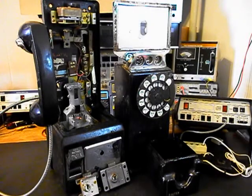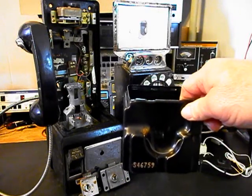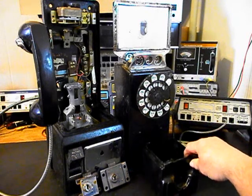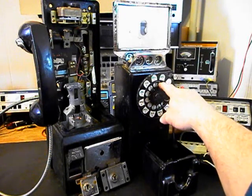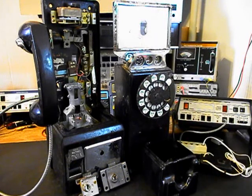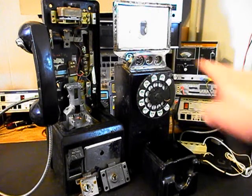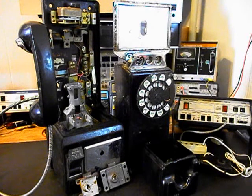We need to locate some locks and keys — a lock for the front cover and a lock and key for the vault area. When we gained access into the unit, we found a coin box, which is a plus. We want to go through the rotary — oil, clean, and adjust it. It is very sluggish, so we'll get that taken care of. We also want to install a dial center card and ring. Merlin is going to take care of the top card sign, the informational sign on this unit.